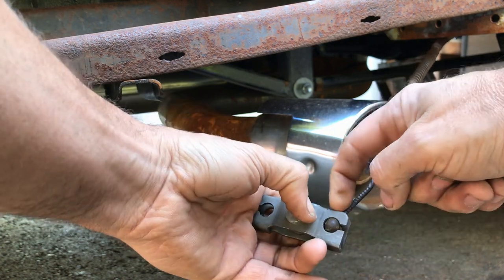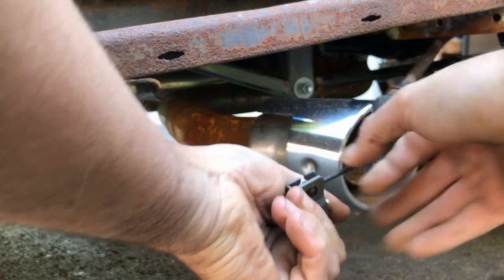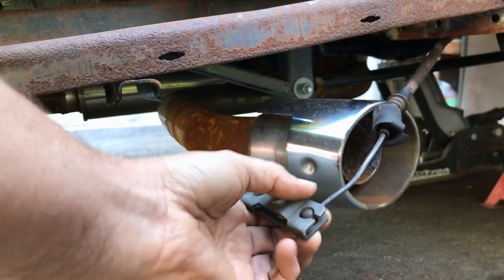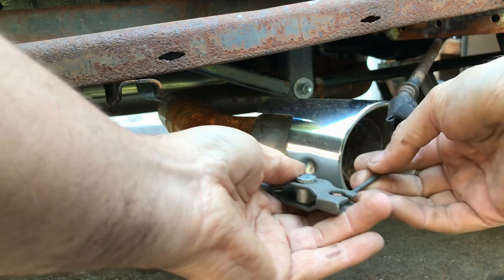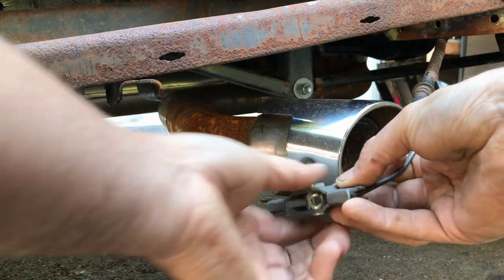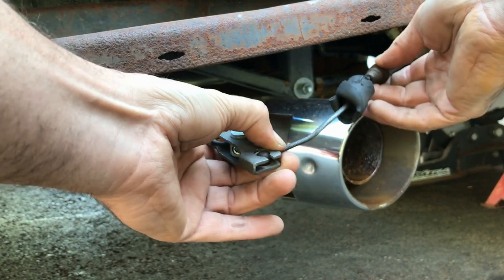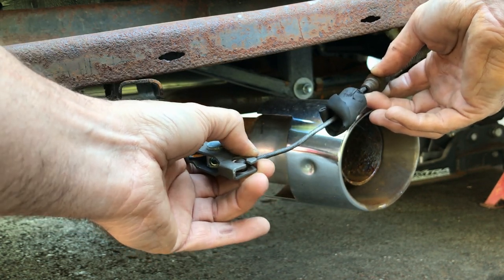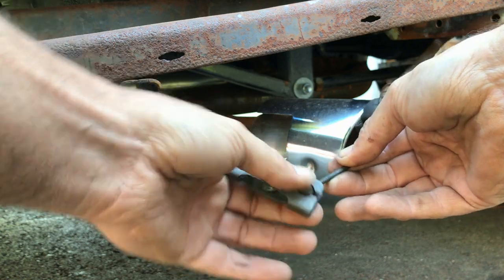Now I could weld a little tab across the top or make some sort of little clamp, but for now I'm going to just close that gap a little bit to make it harder for it to stretch open, and I'll order a couple of new cables. I mean, these cables are pretty old, but they're in reasonable condition, so I'll use them for now. And then I just need to work out an extension from that section to the lever. Also need to make a bracket to hold the two ends of the cables under the body. Probably attach that to the floor, that would be the easiest option of a difficult job. Right, let me go do some thinking, planning, and I'll be back in a minute.